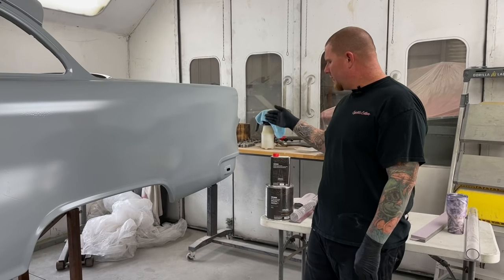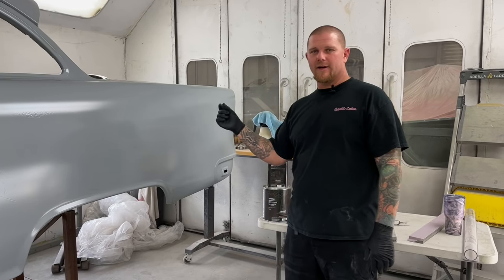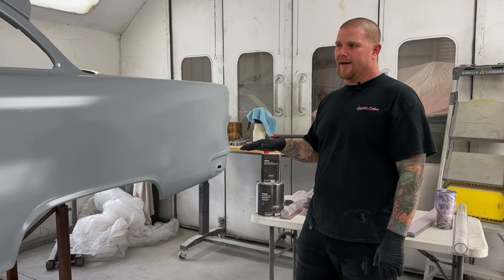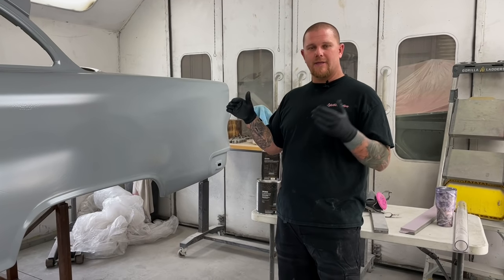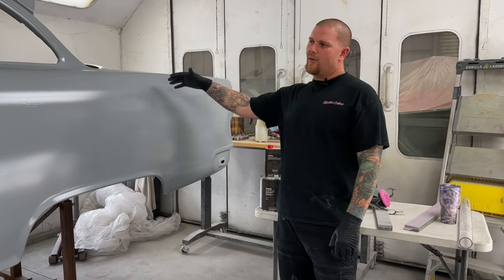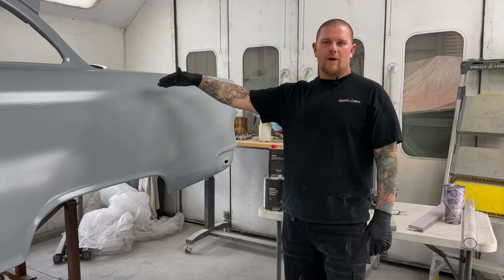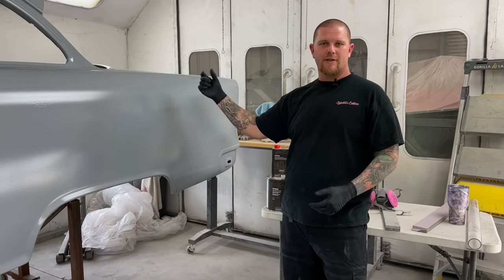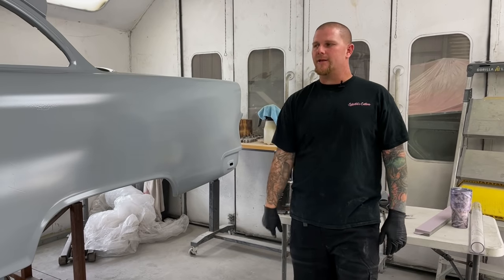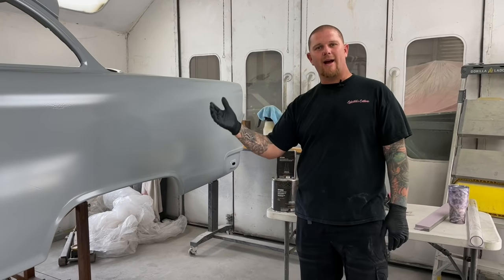As you go through and start blocking this down, you have a very good mill thickness. This is a two-to-one versus a four-to-one. It's like spraying honey, and when you're spraying it, some of the tip sizes you're going to want is anything between a 1.6 and a 2.0. Depending on how good your body work is, anywhere from three to four coats of this epoxy to get the coverage that you want. The goal is you're trying to do one prime, so get your body work as good as you can and then come in with this to make sure you can dial everything in.